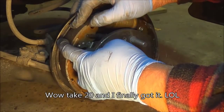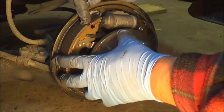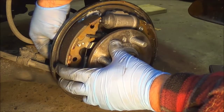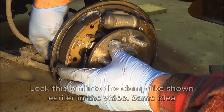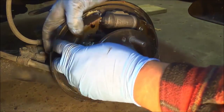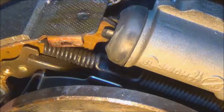Insert the pin. As you see here is a close-up of the wheel cylinder right here, the left brake shoe, the upper return spring, the adjuster which is behind it, the adjuster arm or latch, and that runs right across there and connects to a wheel right there.